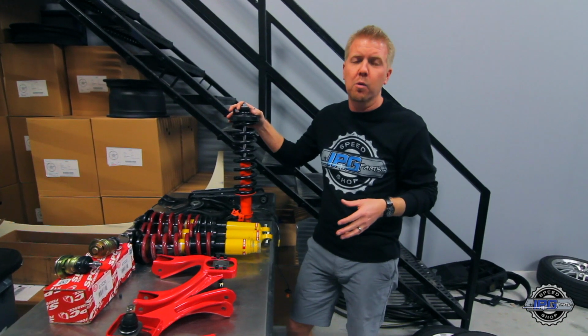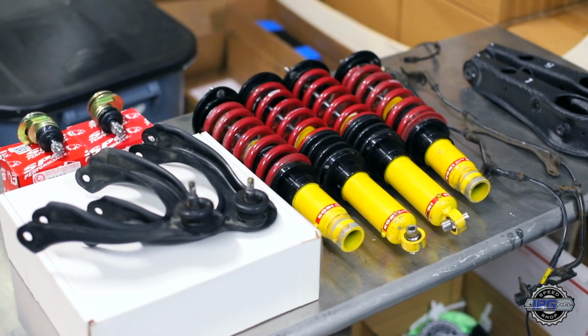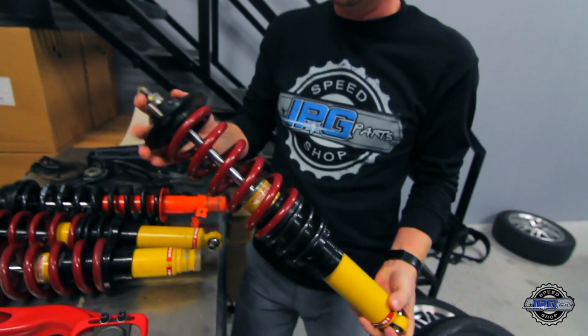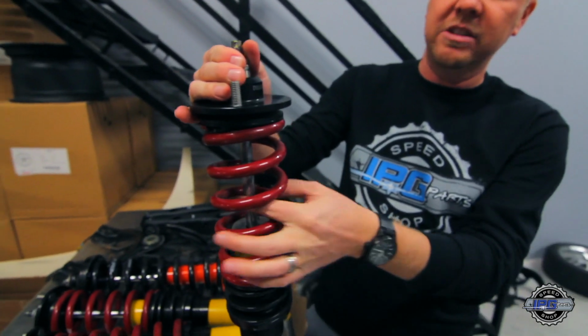So I put some feelers out there, started looking for some good race track suspension, and we came up with these. These are the Koni 3011 series double adjustable shocks. This is a true race setup. This is the top of the line Koni stuff. So you're gonna have rebound adjustment on the top knob. You're gonna have compression adjustment by actually turning the shaft.